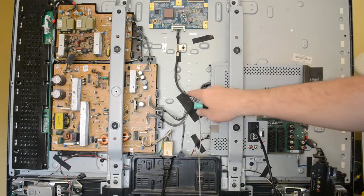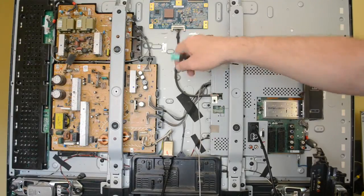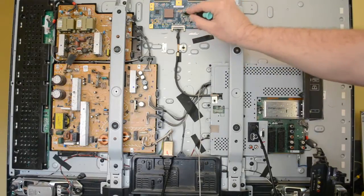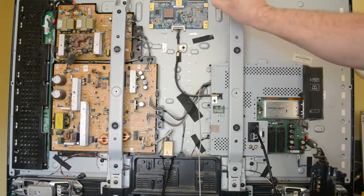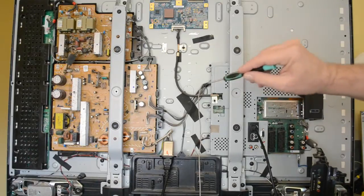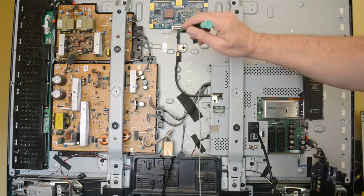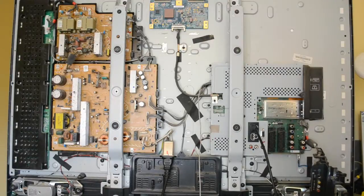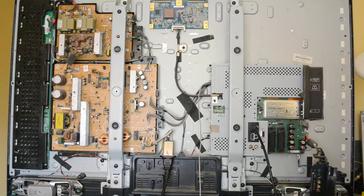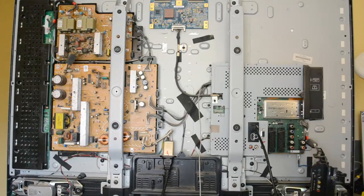Now all the video information comes through this screen cable. You can see hundreds of wires up here, 20 or 30 wires or more, and this T-Con board feeds the LCD screen directly. Now don't do what I do and jump the gun and just order a T-Con board. Take your old T-Con board out first and make sure you get the right one — there's more than one T-Con board for these Sony models, and maybe more than one for your Samsung too. Make sure you've got the right T-Con board before you try and fit it.